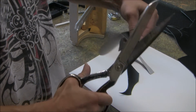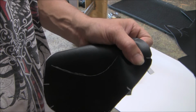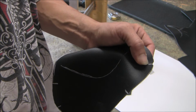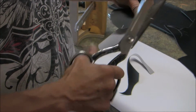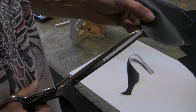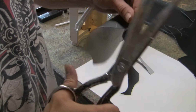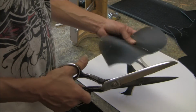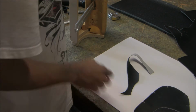Now I'll make small notch cuts. Fold it. Barely notch it. You don't want to notch it any further than the 3/8, 1/2 inch. Some people, factories, used to notch theirs this way. Just a small straight slit. Easier to see like this, and quicker to me. Just got used to doing it like this. So there's our pattern for the side.